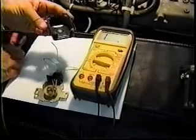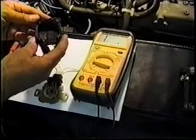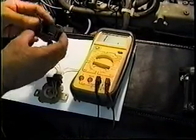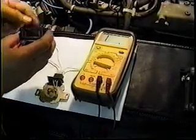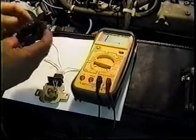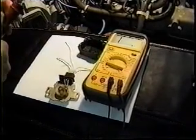By the way, this cover is removable. It does have a tendency to get water down in it. If you ever wash your motor at a car wash, you're going to want to reach in here and pull these two little tabs off here, pull this out and let the water drain out the bottom. If this fills up with water, you're going to have literally a buck and bronco going home.